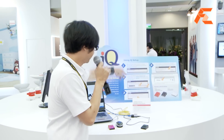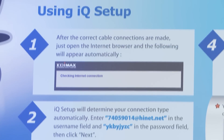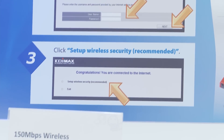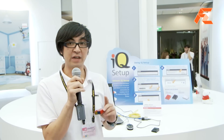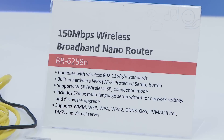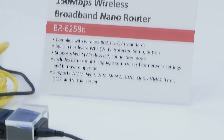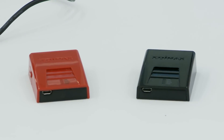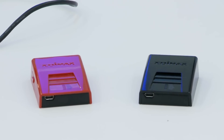As you can see here, after you have made all the appropriate connections — your router to your modem and to your laptop computer — you just click open your internet browser. The usual scenario is that users have to key in an IP address like 192.168.2.1 to access the user interface, and then determine if your connection type is PPPoE, dynamic IP, or static IP.